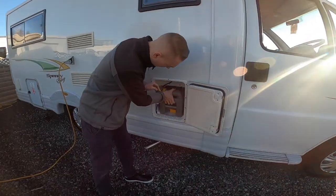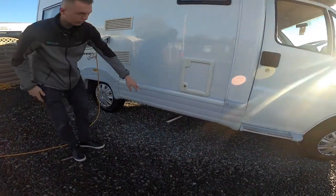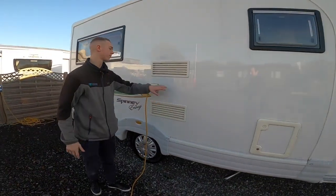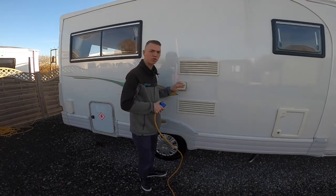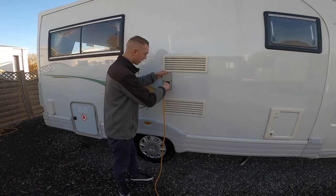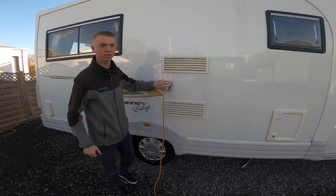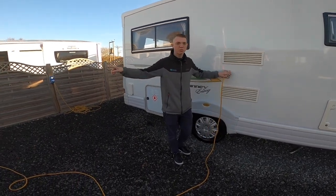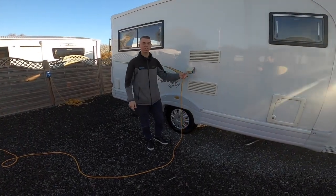You've got your exhaust for the vehicle, your exhaust for your diesel heater, your fridge vents, and your mains hookup point. This is where you hook the vehicle up — lift the collar, expose the ends, clip it on, then hook up to the site. Do it in reverse when unhooking so that you're not walking over the live lead.